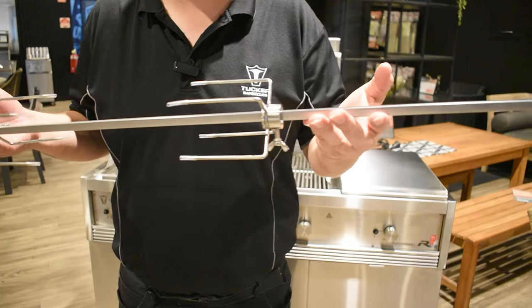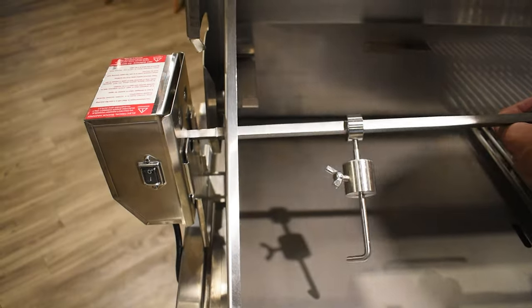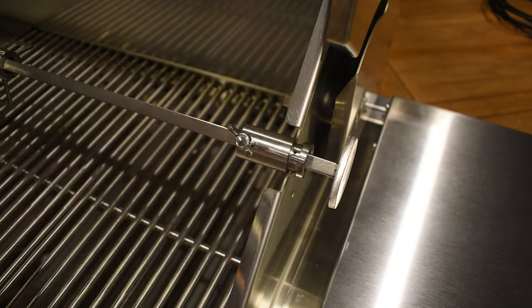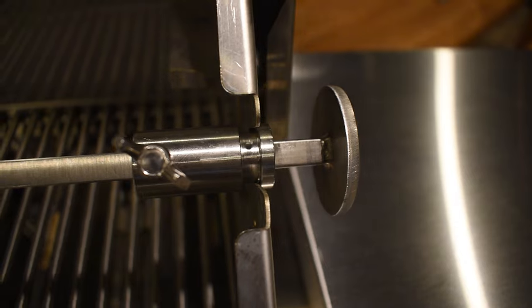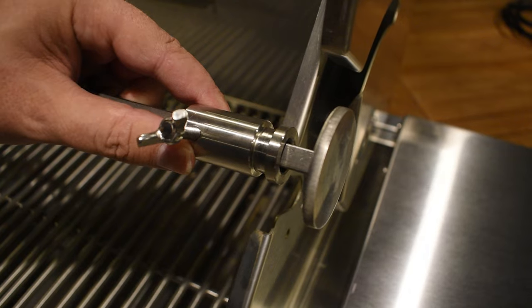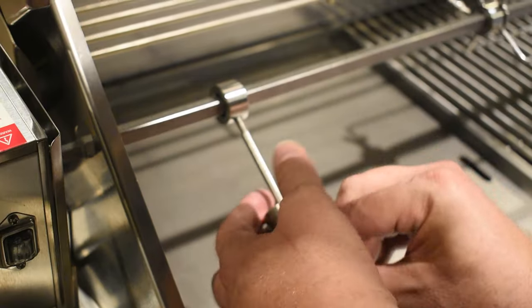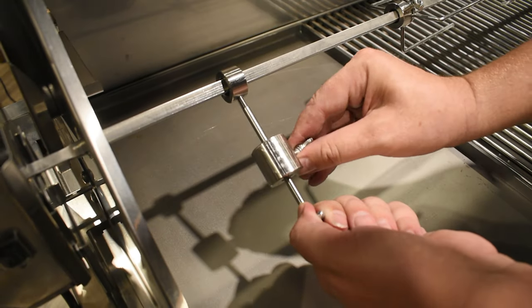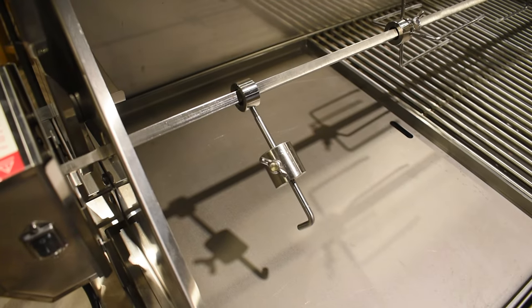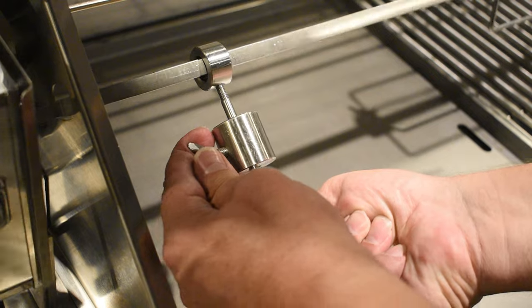Make sure you have the rod looking like this. Insert the skewer rod into the roasting hood and adjust the securing bush so the groove of the bush sits inside the panel of the hood, keeping the rod secure in place. The rod has a slot notch for older hood models. Adjust the counterweight so that the weight is as evenly balanced as possible by positioning the counterweight opposite to the heaviest side of the meat, then tighten the weight in place.